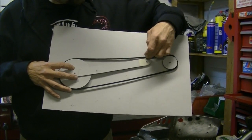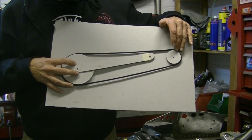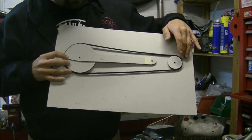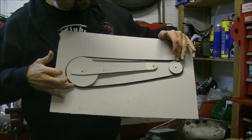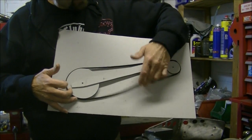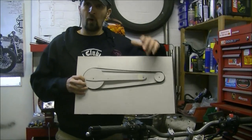It's as simple as that. So when your bike manual suggests tensioning your chain, that's about where it normally sits — with the chain just above the swing arm on top — and you have that inch and a half to two inches of slack. That's so that when it bumps up and down, it doesn't go any tighter, because the tightest point is where they're all in a line — that's over a bump with luggage and a passenger on the back. When it goes over a bump and drops, all that slack is accounted for. Very, very simple when you see it laid out in a model.